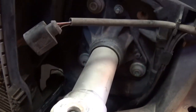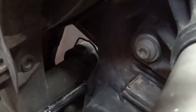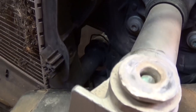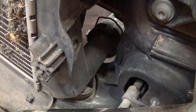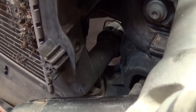You can get something long and push on the plastic part of the hose. I have a feeling this one will be stuck pretty good. Make sure you have a container underneath because you're going to make a mess — coolant will leak out unless you've already emptied the system. Then you just pull it out.